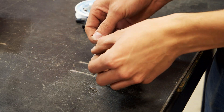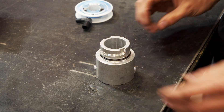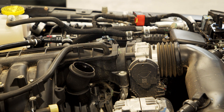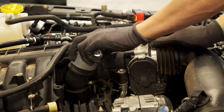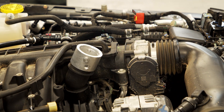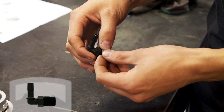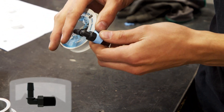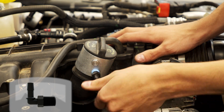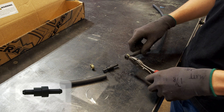Put the O-ring onto the bottom of the adapter. Remove the oil cap and install the adapter. Put Teflon tape onto the threaded 90-degree fitting and install it onto the adapter. Make sure it points upward at about a 45-degree angle.